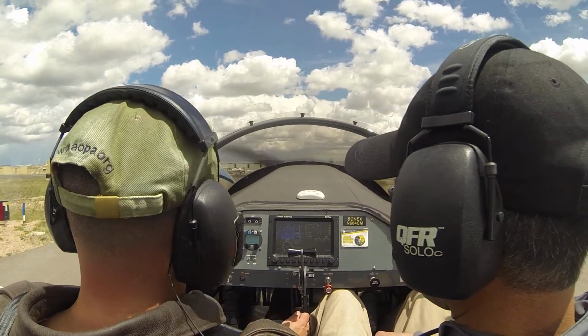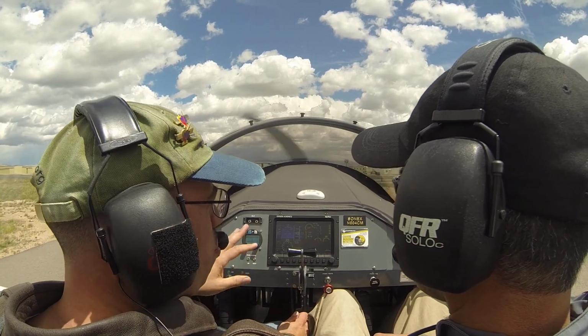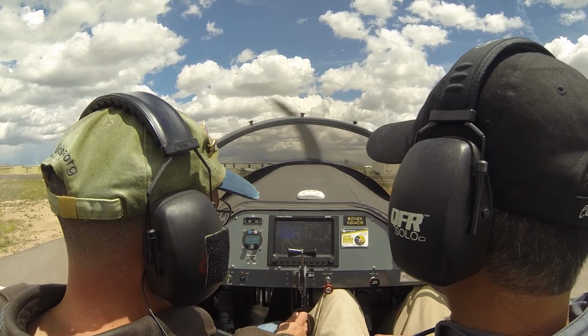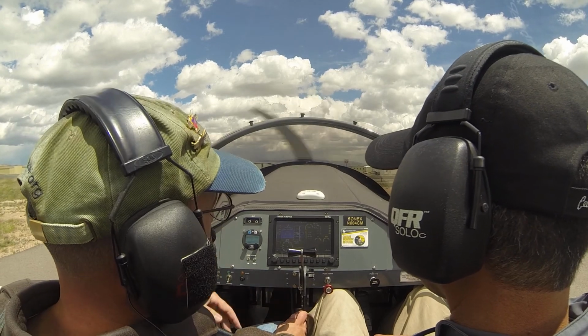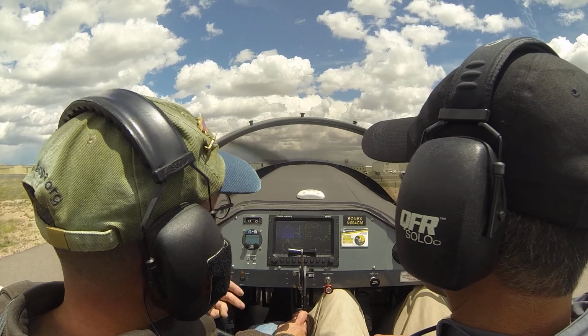Got a little bit of a stumble. When it gets heat soaked underneath, you get a little bit of fuel vaporization and all that. Setting the mixture right usually eliminates that. If it's too rich, believe it or not, it tends to do that.